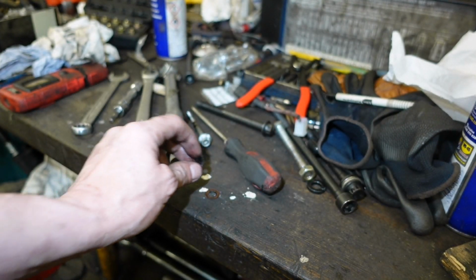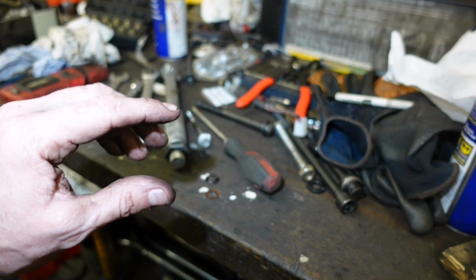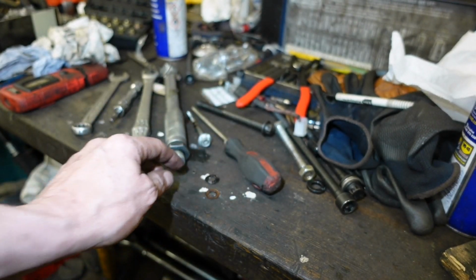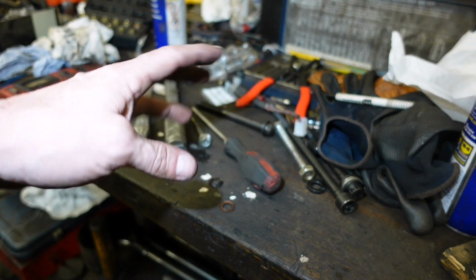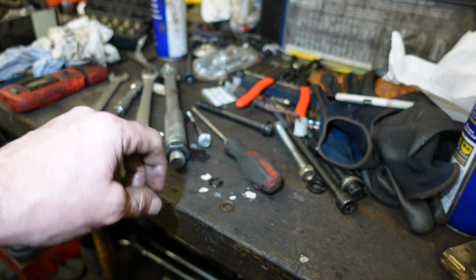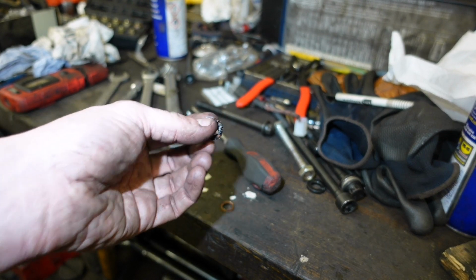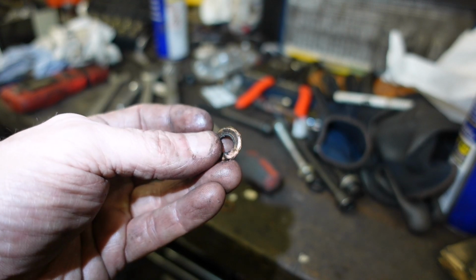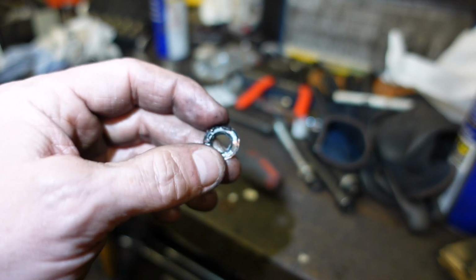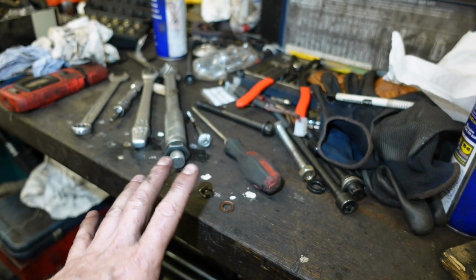The problem with blowing by in that particular design is because the injectors are in the rocker cover. So if the combustion gases blow by off these seats, your carbon is going to go into your engine, get stuck in the pickup, and turbo pipes and stuff like that, and it could destroy the engine. So that used to happen to the early Toyota D4D 3 litre engines, where the injector seals were bad, and Toyota changed the injector seals out. But people still recommend that you change the injector seals maybe at 100,000 miles in those engines, because the blow by can get inside the engine. That's the whole problem here.